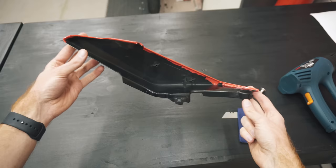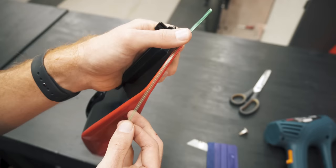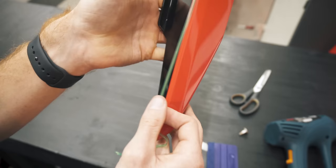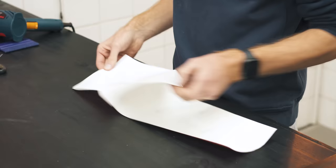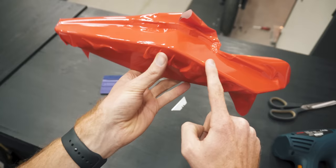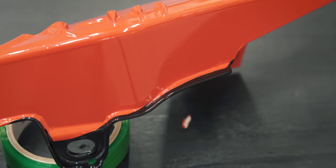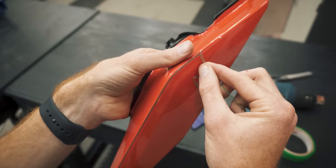For the top layer, it's best to do the highest piece of vinyl last so that the seam doesn't have an upward facing lip for dirt to rest on, bringing more attention to it. Lay your cutting tape along the line you previously made, but with the filament about 3mm onto the vinyl so that the top piece will slightly overlap, but not too much. Apply your next piece, ensuring it's well over the cutting tape. We don't need to go all the way to the edge since this part will be covered by the seat. And finally, the cutting tape works the same way again — being careful when removing the remaining tape, because this will be the visible seam.